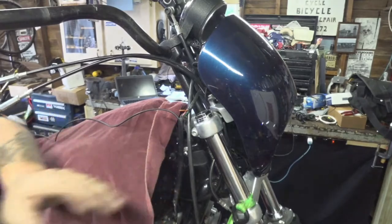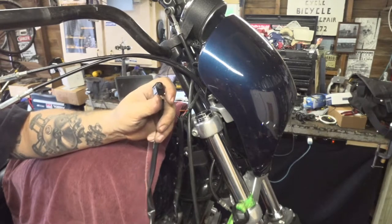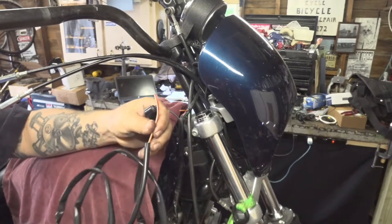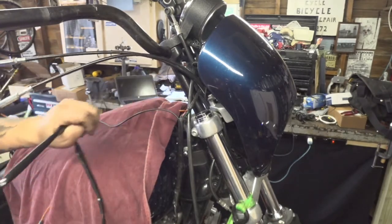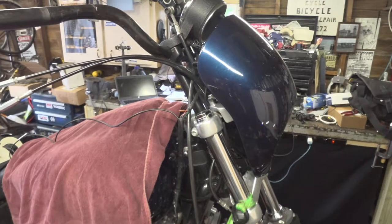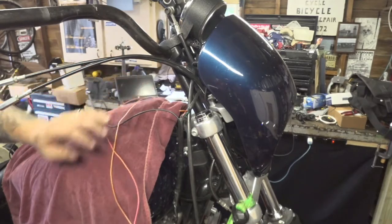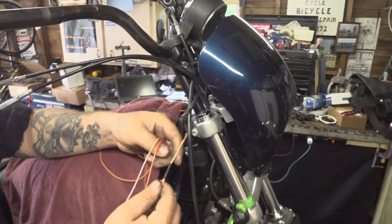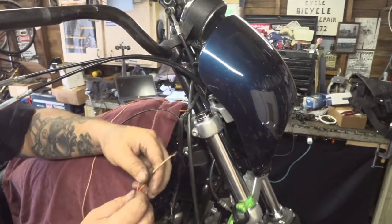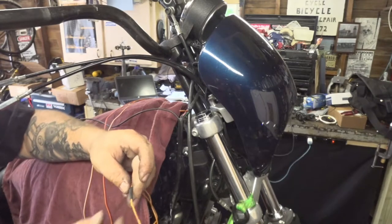We're going to take a brake light switch out of the package. They gave me a notably longer one with about the same wire colors, which is nice, and notably longer sheathing. However, we're not going to use that sheathing in this instance. I'm going to drape our new brake light switch up and match it to our old one, then cut this open and do another soldering connection to attach the new brake light wire, making sure we attach it at the same length so we don't get any weird unsightly lumps in our wiring harness.